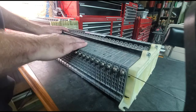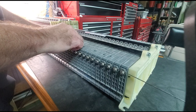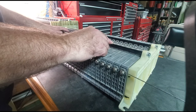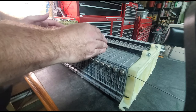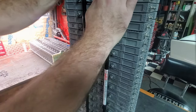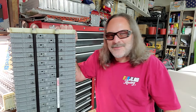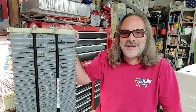So now we can take the nuts and wires off and pull the pack back apart, so we can put the cells back in the proper orientation. When I do that, I'm going to take the highest cells — the ones with the highest values — and put them in the center where all those bad ones were, and put the lower ones on the ends. They can be put back in the series configuration with my strongest ones in the middle. I'll put my end cap back on — torque these down a good amount. She's put back together, ready to go back into the high voltage assembly and then back into the car for many more miles.